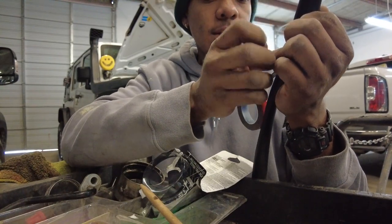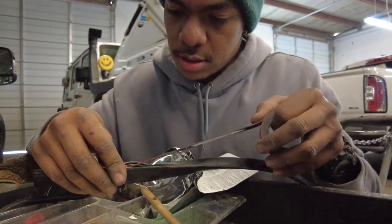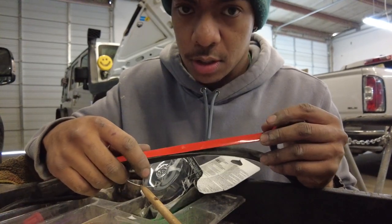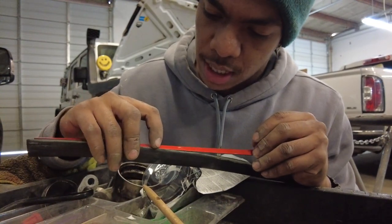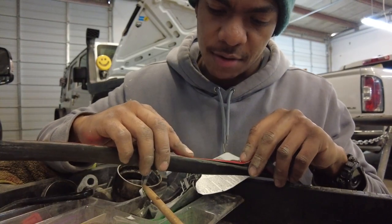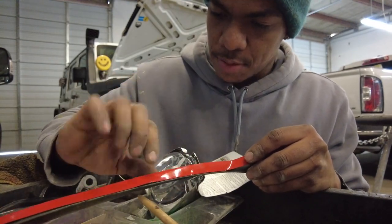And it might not set down in place, but this stuff is pressure sensitive and that will activate the tape. So if you are going around some hard corners or you're having a hard time, just take it slow and be light on the pressure, because then it'll allow you to reset it and you might be able to save your bacon.